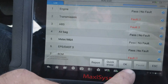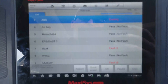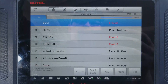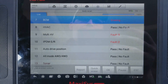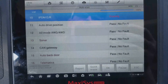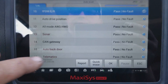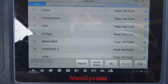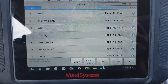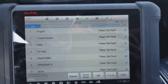We've got a couple other codes on this one relating to the vehicle being taken apart, so I'm just going to do a quick erase. But yeah, that's all there is to it — it'll automatically calibrate most of the cameras on the Infinitis with the Autel. There are very few you have to do a manual calibration on, and once I get one of those I'll do a walkthrough. Just look for the AVM module, find your fault code, do the initialization, and that's all there is to it. Thanks for watching!